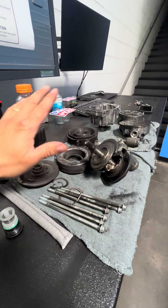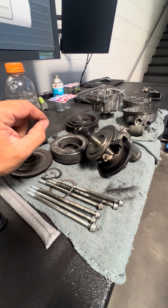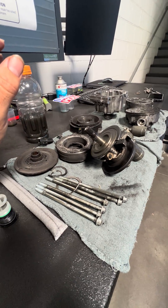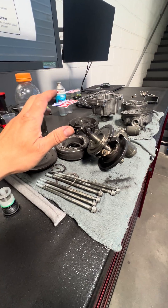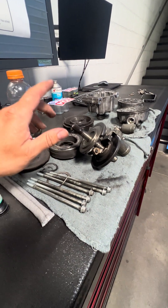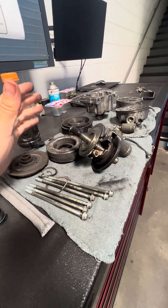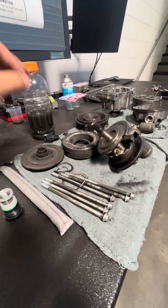To avoid this altogether, get your AC recharged once every five years — that's nothing. And if you do have a leak, don't just recharge it. Do not buy the shake cans — that stuff is junk, it'll ruin your car. Get it professionally looked at and get the leak fixed.